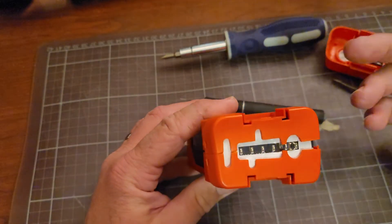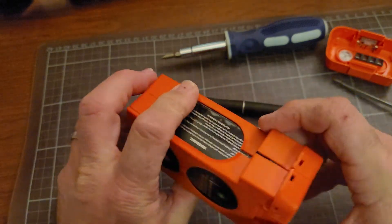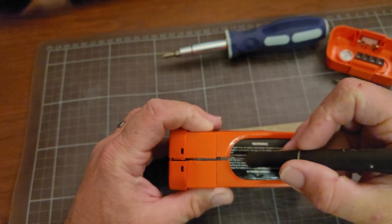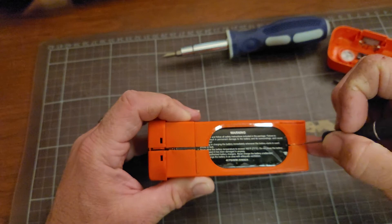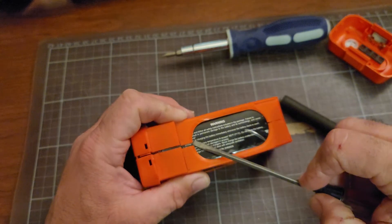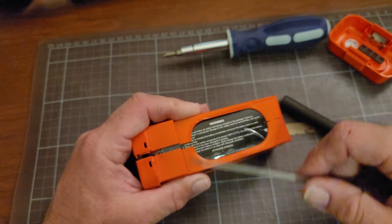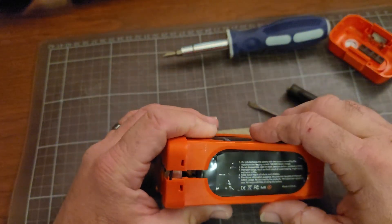This one is charged, so I need to be a little more careful with it. I had it taken apart and then put it back together and tried charging it to see if it holds a charge — and it does actually hold a charge. So just score these joints, which takes a little bit of time, until the battery starts to separate. Then I took a flat screwdriver and carefully pried a little bit, wiggling to help separate it out, working both sides and taking some time.